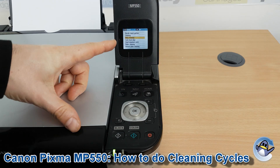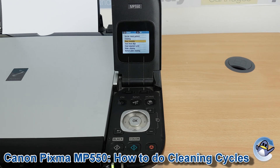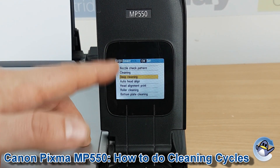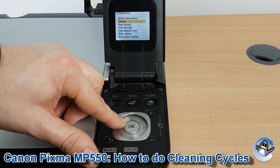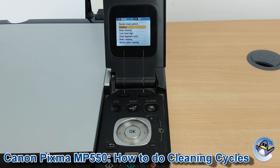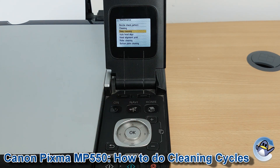The reason there's two options here is these cleaning cycles force fresh ink into the printer's printhead to hopefully dislodge any dried or congealed ink in there that could be causing print quality issues, and as such the severity of the clean uses more ink. So if this is your first clean I'd recommend sticking with standard cleaning, checking the result, then moving on to deep cleaning if you have something pretty severe.